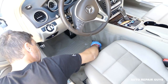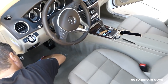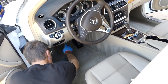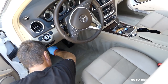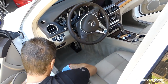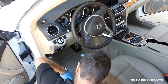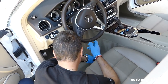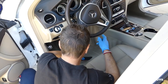You should do this on a very hot day so everything can dry. Leave the car open for a few hours — never close it until everything is completely dry. Never get the carpet too wet; just a little moisture is enough to clean it, because there are electronics under the carpet that you could damage. It needs to be warm so it dries all the way and you don't start growing mold.